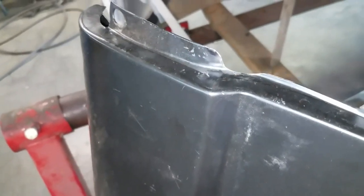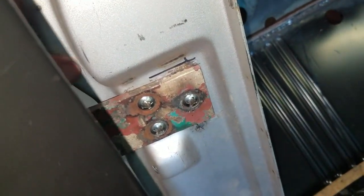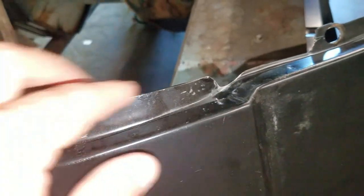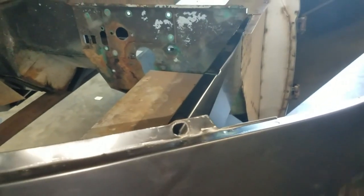You can see that part of the A-pillar I'm talking about is right in here where the fender rolls in — that area was really tight, so I had to work that out. The rest of the fender support was actually pretty good. I don't like all these square edges, but we'll clean all that up. Right now everything is still rough — I'm not grinding yet. I like to do all that one time because you get filthy and the shop gets destroyed, so we'll just fit right now.